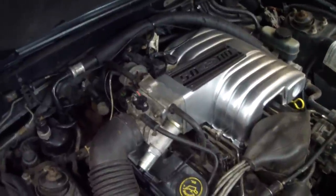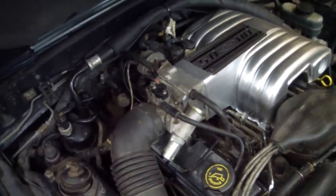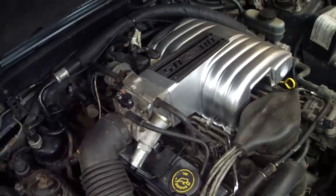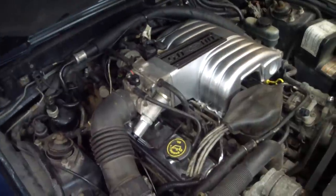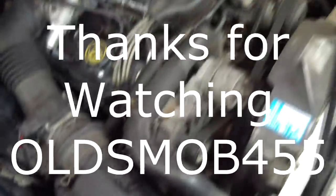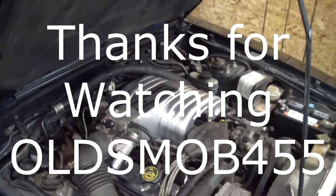Back at the shop, pretty happy with the setting I got. I've heard it suggested that this setting gets affected any time you change anything on the engine like fuel pressure, injector size, or cam — so you're supposed to revisit this setting. Now that I got my Mustang running the way I wanted to I should probably take some time and clean up this engine bay a little bit. So that's all for today — thanks for watching.